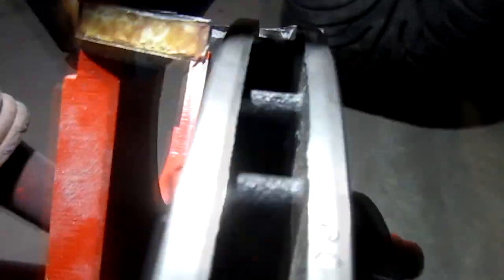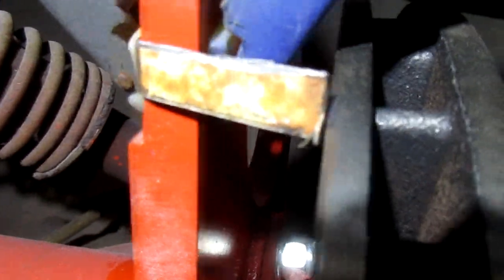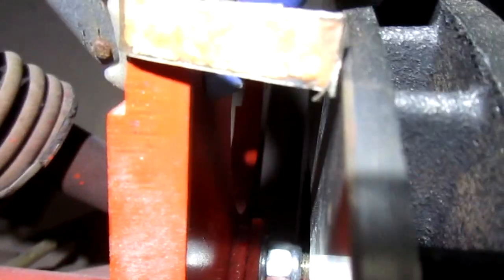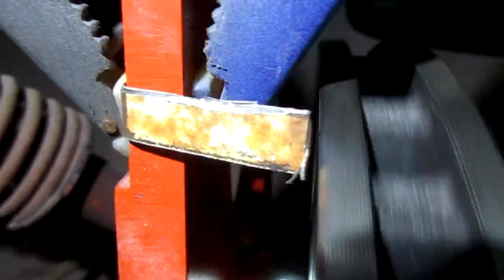So, I went ahead with my rotor on, had the caliper on, and I noticed that it was wobbling side to side like this. I can show you — see here's my little guide, right there, right there, that's touching a little bit, and it opens up way like that. See that wobbling there?